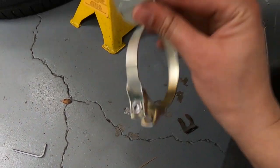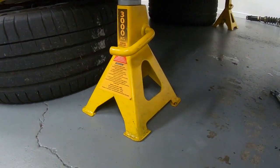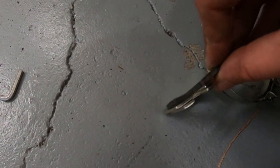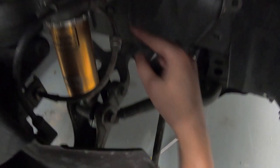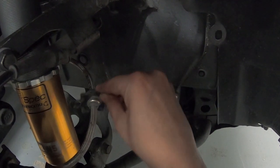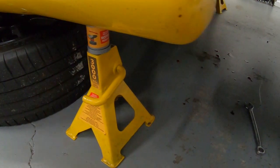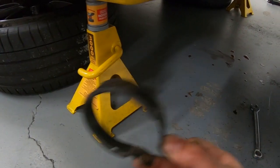Minor adjustments. So this was the collar that was around the Ohlins that came factory. However, the collar has a double layer on it, and if I can roll the camera down, it's only as thick as one of these, so we can't get the brake thing on. I don't even know what you'd call that piece. This spring clip that you then slot in place. So we're gonna have to just take this collar from the BCs and whip it onto the Ohlins.